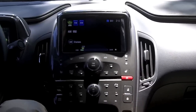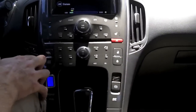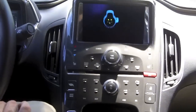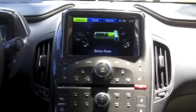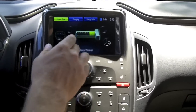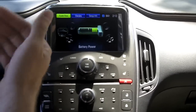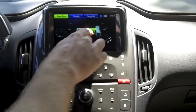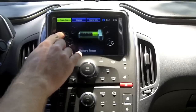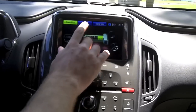Now the hard keys: lock, unlock, and the leaf and drive mode buttons. The leaf button brings up a power flow chart. When making forward progress, it shows energy flowing from the battery to the electric motor. In regenerative braking, it shows energy coming from the wheel back to the battery. Once in range-extended mode, the gas engine appears as well, so you're never guessing how power is flowing through the vehicle.